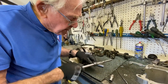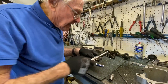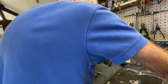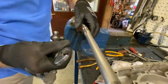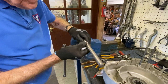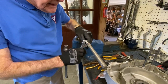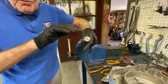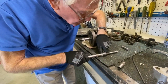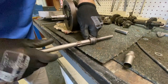As you see there, what I've done, that size is small, undersize, that size up. So what happens when you adjust the reamer? You take that off there, and then you bring that down, and you pull that down there, so that gives you more cut, as it were. We wanted to go the other way, so I'll take that. So that should just give me enough room to get through here. Maybe a little bit more adjustment. No, it's not. So I can just gently cut that through there, like that.